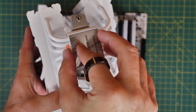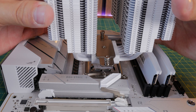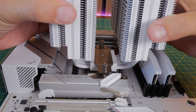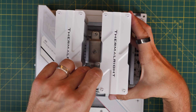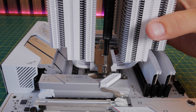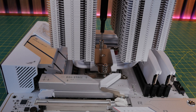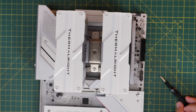Remove the little plastic protective cover on the heat sink, then line the cooler up. It sits down on the two screws sticking upwards from the bracketing, so seat it down carefully without rubbing it around too much so you don't disturb the thermal paste. You'll need a long screwdriver — a short one makes this quite fiddly. Screw one in a little bit, then move to the other and go back and forth between the two screws until it's nicely secured and you can't tighten it anymore. Don't force it, but do make sure it's tight so there's good thermal contact.